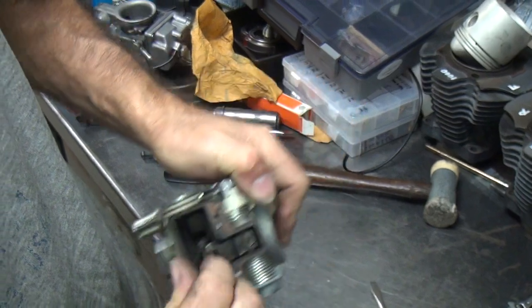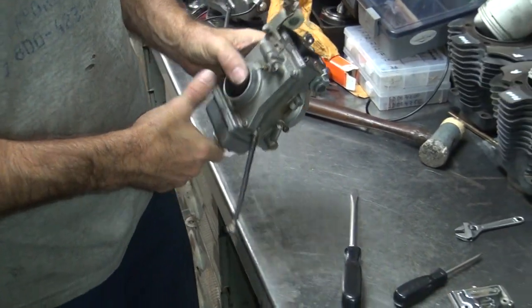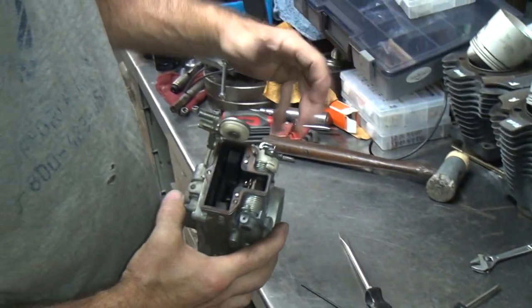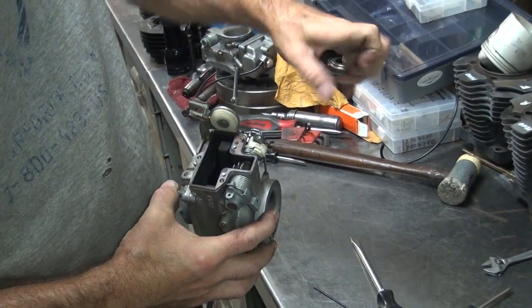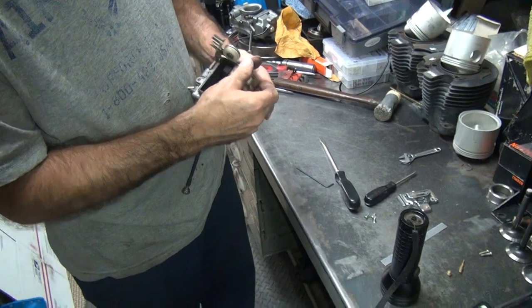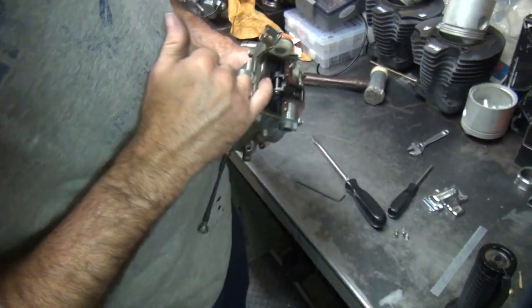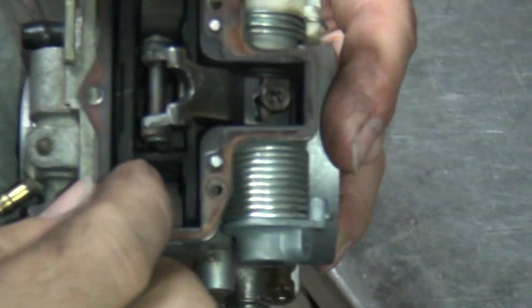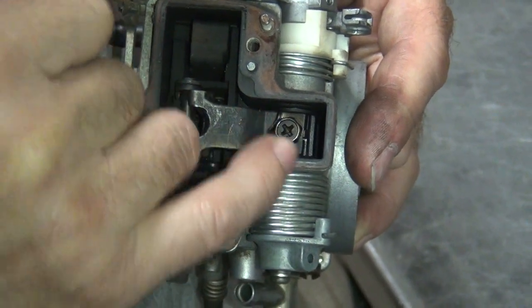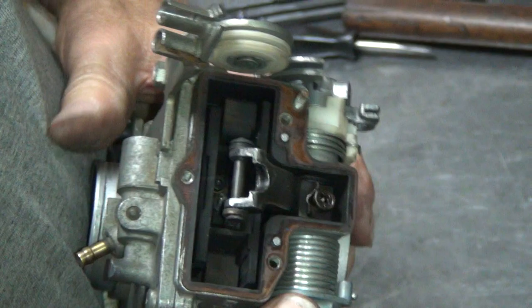Tightened up. And we're back like we were. All right. I got blood back in my thumb a little bit. Well, at least in a minute. The meat swells back up. Okay, now to get that all apart, two ways of doing this. You either take the pin out of here and slide the pin out and hope that's enough, or you got to take this bolt out with the lock tab and undo the whole lever and pull it all as a unit. And it's about a toss up on which one's easier.